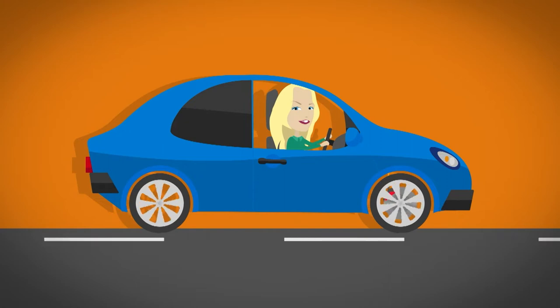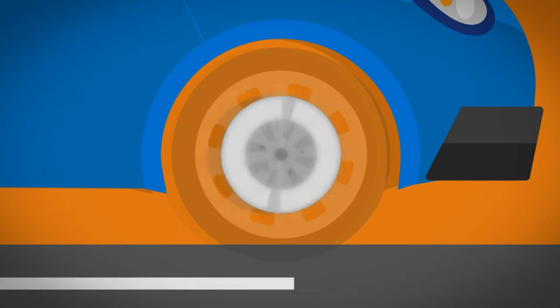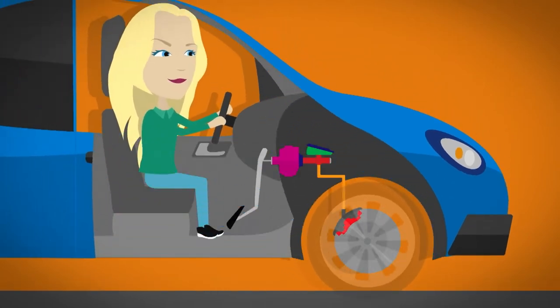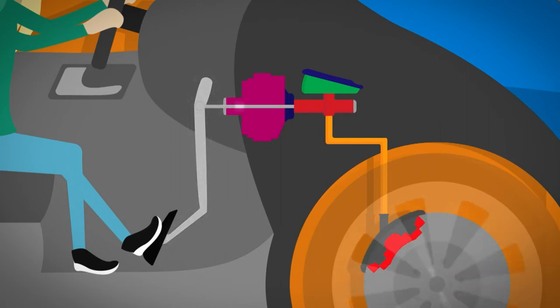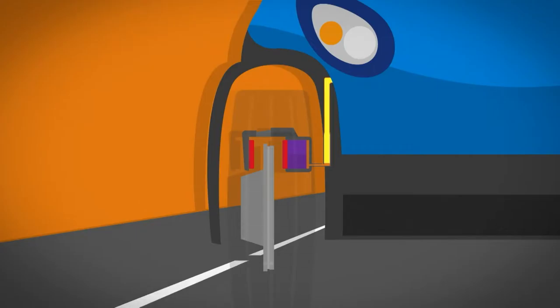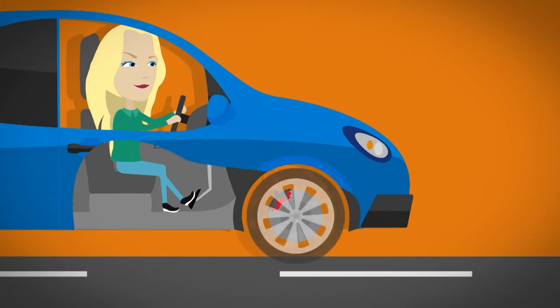When a car is moving, the wheels on the car turn around. Behind each wheel is a metal circle called a brake disc — this goes round at the same speed as the wheel. To make the car slow down, the driver presses the brake pedal with their foot. The brake pedal moves a lever which pushes against a metal cylinder with springs inside it. As the springs are squeezed, a special liquid called brake fluid is released. The brake fluid travels down a pipe to the wheel and flows into the caliper — this pushes the brake pads onto the brake disc and slows it down until the wheels and the car stop moving.